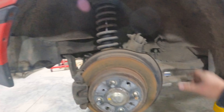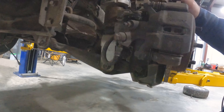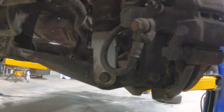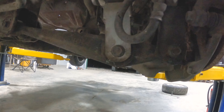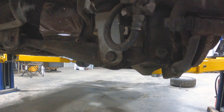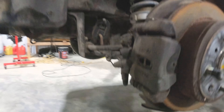With the back wheel off, we can see what's going on here. These things are really not that hard to take apart and this one's not rusty at all, so it should be a pretty swift teardown. Talking to S1, I wasn't quite sure what brand these coilovers were, so I don't have the hardware to hook up the coilover. The lower control arm may still work — I can still run that. I'll be able to take the whole swing arm assembly off, take the hub, brake hub, and caliper — all that good stuff. I'm going to go ahead and start disassembling this side, get the sway bar and all that crap off too.